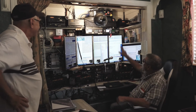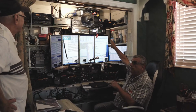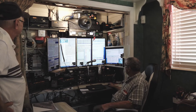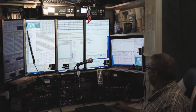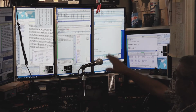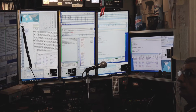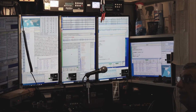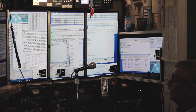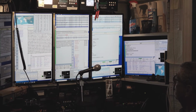Well, here, see now, all the keyboards will independently operate with that computer, 3 computers. So 3 computers, 3 keyboards, but one mouse, and it allows me to go anywhere here with 1 mouse and 1 keyboard. The only stipulation is that the mouse has to be on the screen that you want to use to type. Right, so you've got that mouse going across different computers. Yes. Is that a quick explanation, or does it take a long time? No, it's just a program that does it. KVM switch. It's just a program that runs it. And you set up the monitors, where you want to go, which computers they are, and so on and so forth, and you're ready to go.